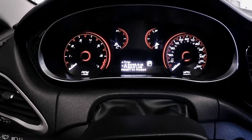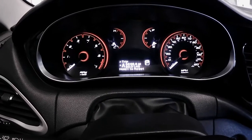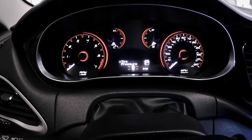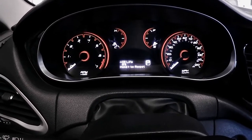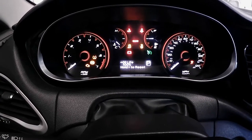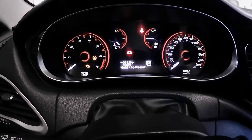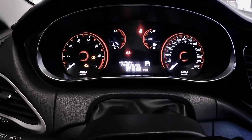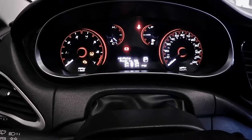Okay, I'm at 66.96. I'm gonna hold the reset. I use my A-trip to look at my oil change, so good on oil change. Went down to 6% life. I'm going to hold the reset. I'll bet I have to have the key on. There it is. So the key has to be in run position for it to reset, but not running. Yeah, we got cold and it's complaining because my tire pressure dropped to 30.